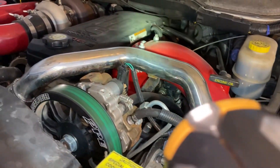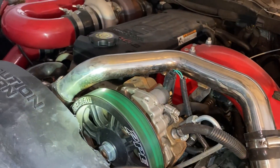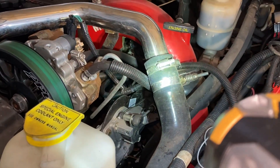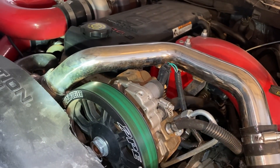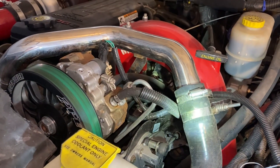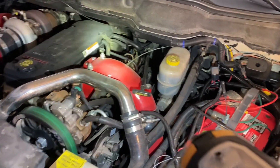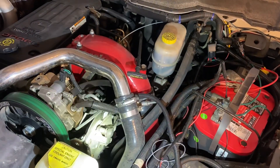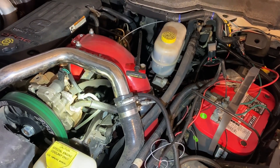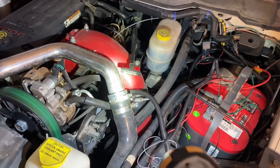The kit comes with a radiator coolant pipe and new boots, so you replace the factory radiator hose in that area. I had issues with these leaking coolant around the top through multiple heating and cooling cycles, but I was eventually able to tighten and readjust them to stop the leaking — I ended up putting two hose clamps on one of them. Also, when installing this kit, take off your air intake horn at the very beginning. I didn't and got through almost the entire installation with it on, which made it much more difficult — and then had to take it off anyway to tighten the nuts on the high-pressure line.